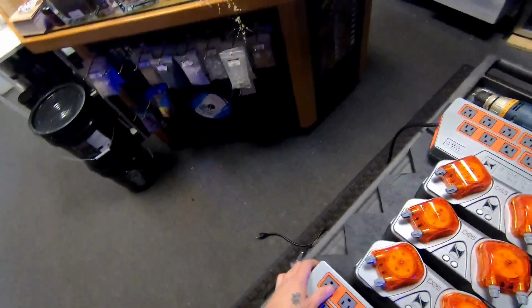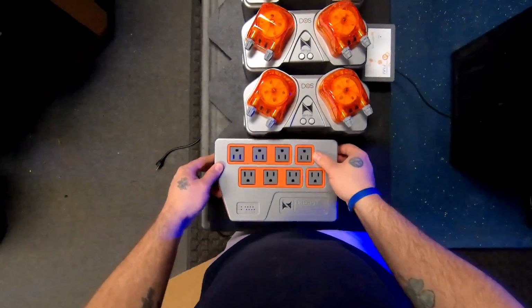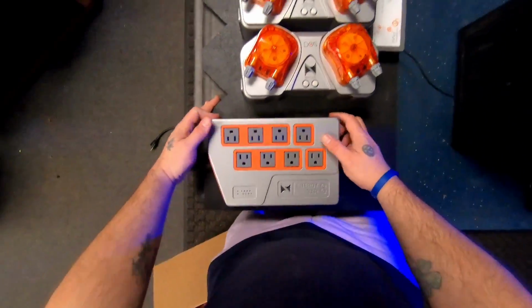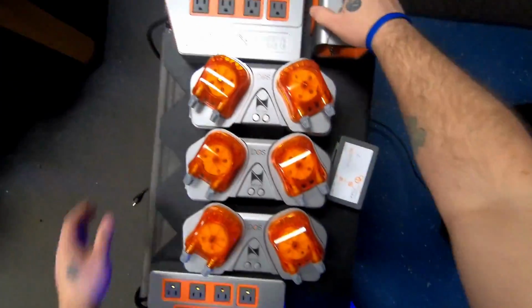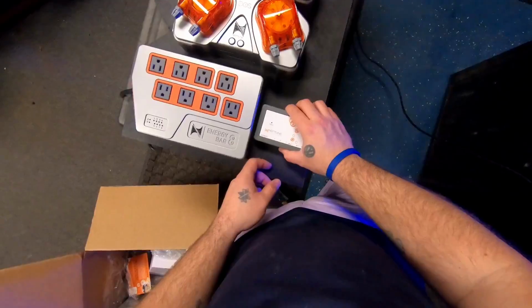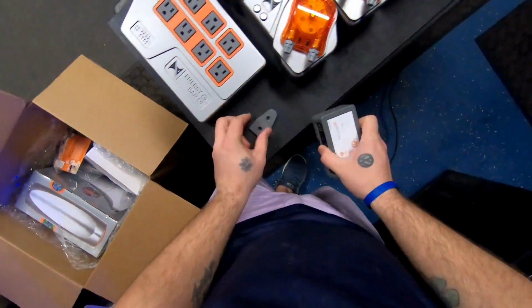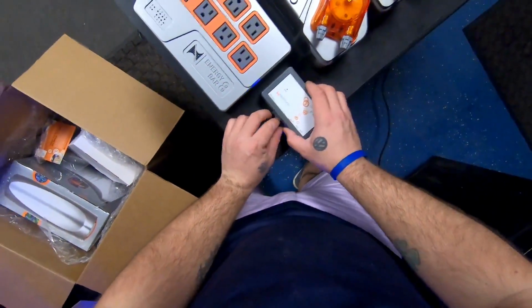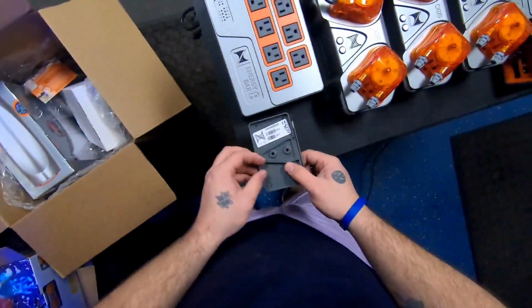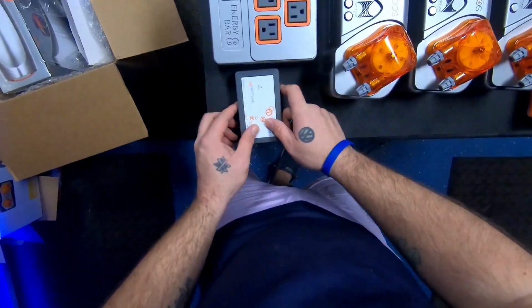And talking about the Aqua Bus cables, they're not USB cables. So I know that some of the literature says that, but if you just buy this thing and you don't read each individual part and you go start plugging stuff into your computer, you're gonna fry some stuff, because a lot more power goes through these Aqua Bus cables than goes through USB, and you'll catch something on fire or burn it up.